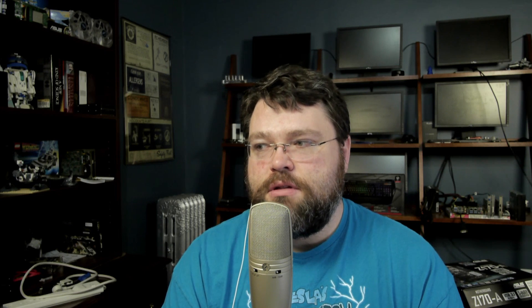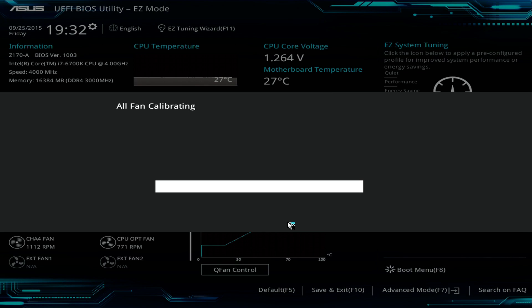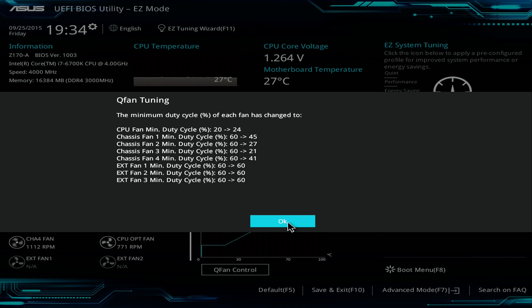In the UEFI, you can also pick for every fan header whether it operates in DC or PWM mode. This UEFI adds another feature: auto fan calibration. You go into the UEFI, set the option, and it ramps all fan headers up and down, finding the minimum DC or PWM levels to spin each fan, as well as the minimum and maximum RPMs, so that your calibration curves and fan controls can be exactly what you want. If you want a whisper-quiet system or fine-grained fan control, this motherboard has that feature.